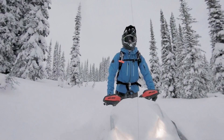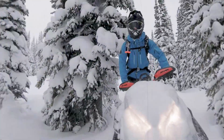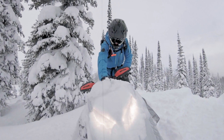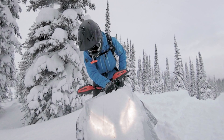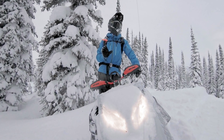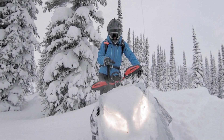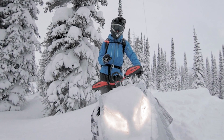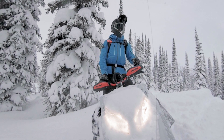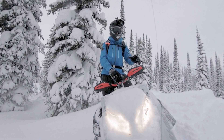And back down to the meadow where everybody's kind of already ripped around — I want to get back into that fresh stuff. Now as you guys probably already know, the way that the ECU works with the turbo is it doesn't actually make more power — it's basically an altitude compensator. So when we're up here at, say, 2,100 meters, the way that the turbo compensates — or the ECU — adds boost to compensate for elevation up to 10,000 feet, which is around 3,000 meters or so. By that point on a naturally aspirated sled with 165 horsepower like this one, you're going to lose about 40 horsepower. So the turbo just adds that right back in. You've got all 165 horsepower at that elevation, and then anything higher than that you'll have 40 more horsepower than you would on a naturally aspirated sled. So when we're doing mountain riding, we're up at elevation — it's perfect, that's where this thing works so awesome.